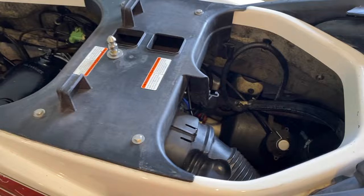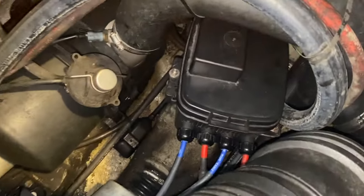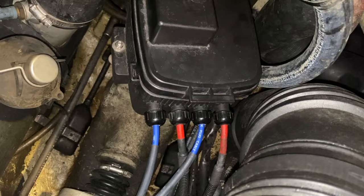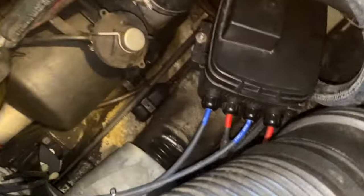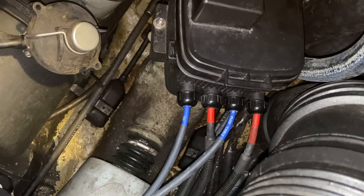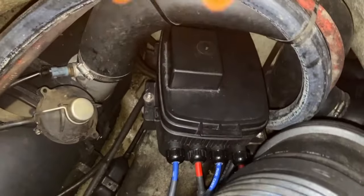There's a little white storage compartment that houses backup spark plugs. This is your center brace for your forward seat. Coming back here, there is our electrical box. You see two blue wires and two red ones — the two blue wires feed upstream and secure onto your spark plugs. The red wires are for your starting system and battery: one feeds power to your starter relay while the other feeds into the bottom portion of our starter. Back to the electrical box — let's go ahead and open it up.